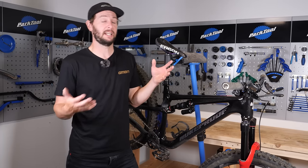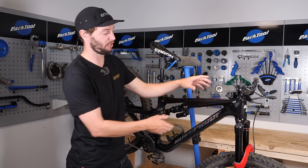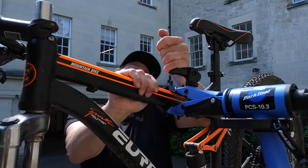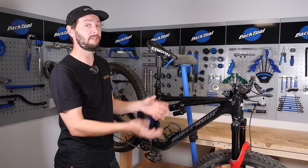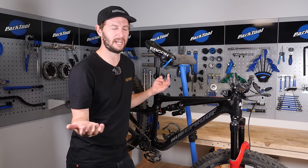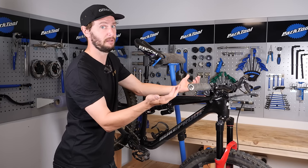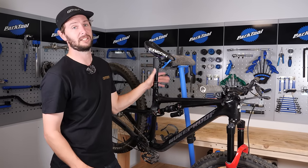If the only way you can do it is clamping it to the frame, then please be really careful when you're tightening up, especially on things like the top tube. If you put the jaws around that and tighten it too tightly, especially with a carbon frame, you can actually squeeze and crack the carbon without even knowing it. Another big one I've seen done before is bikes with external cable routing — the cables running on the outside of the frame. People have actually put those in the jaws without realizing it and crushed the hose or the cable. When you come to bleed a brake and it's not working — it's because you've clamped the hose too tight. Same with cables: if you clamp a gear cable in those jaws and you're there changing gear, the cable's not shifting because you've squeezed it. Just be really, really careful. I would always suggest: just go and clamp the seat post.